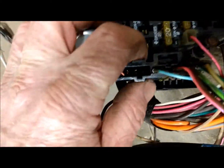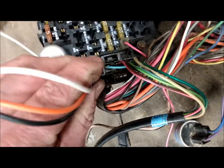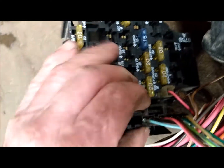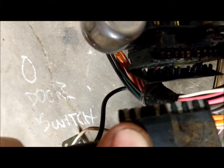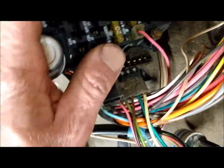There is a tab in here that you have to push forward to get this connector out. The second connector that plugs into that is your dome light interior of the car, which plugs in right on top of that. I'm realizing that these connectors probably get corroded and dirty in here — that's why my brake lights were not working, and it could also be the fuel gauge issue. You should pull that apart; this tab has to be pressed forward to get this connector out — it's a two-piece connector.